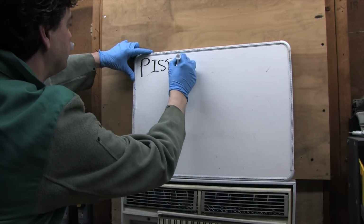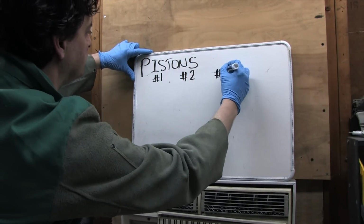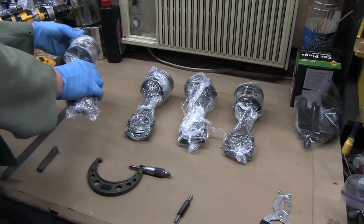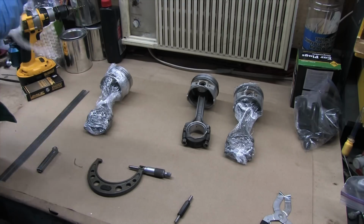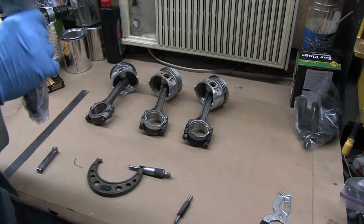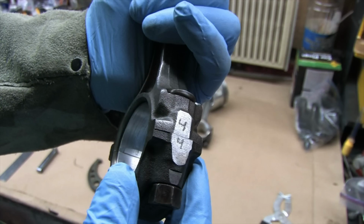Oh, never mind. I've got a crusty set of 30 over non-turbo pistons pressed onto 6-bolt rods that I intend to keep using. Before I tore into this job, I was told that they will all be out of spec and that this is intentional. I'm not expecting to find anything different. Everything else I've been told so far has been true.